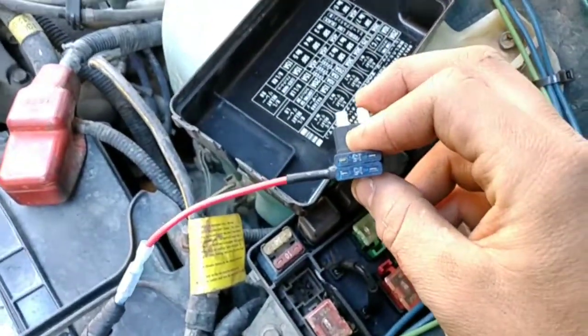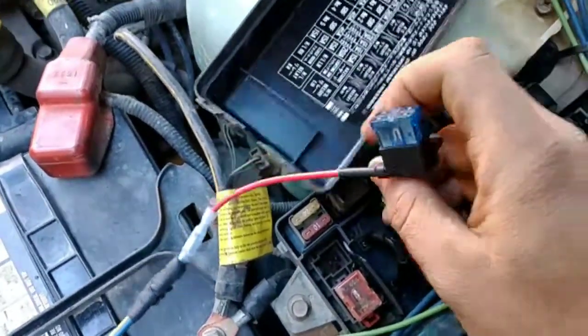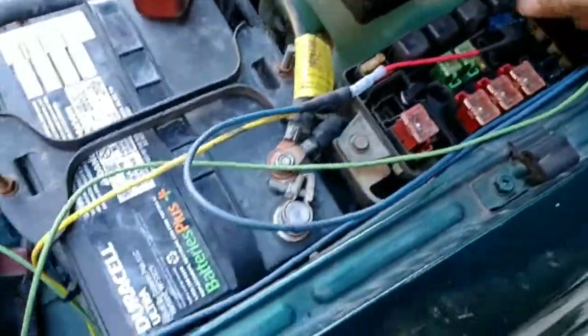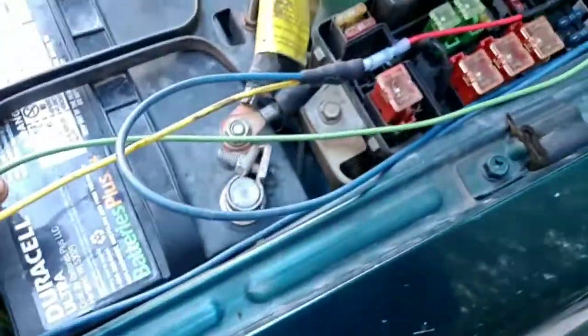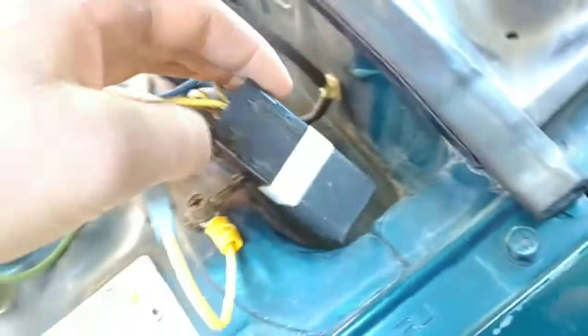This is in for my headlights and rigid lights. This is the out for the headlights, and then this wire here is the out for my rigid lights. They just run on the same power, so I can run a fuse and not burn my car down. I ran the positive up to my relay up here.